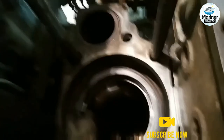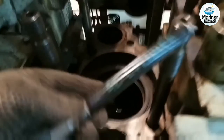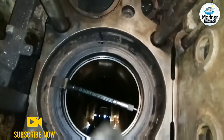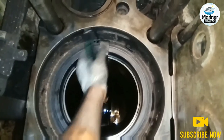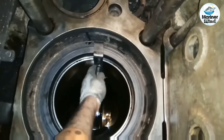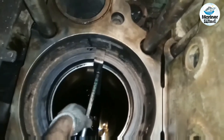This is the gauge used to measure the cylinder diameter. Basically, this is a micrometer. The gauge is placed in the forward-up direction and measurements at all three points are taken. The bottom point measurement is difficult from the top, so try to take it from the bottom. There are chances of the gauge falling into the sump if not held properly.